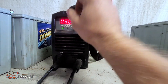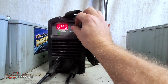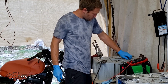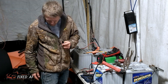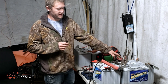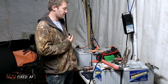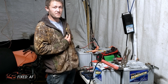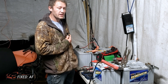Welder hooked to the battery. I cranked it up to 30 amps, let that sit for a couple of minutes until I saw some bubbles, then ran it right up to 85. Here you can see me in a panic removing the vents on the battery I'm desulfating before it explodes on me. I've spent about six hours on these batteries and I've got one left. While I've got them to hold 12 volts, their amperage isn't very great, so I'm probably going to have to buy new batteries anyway. That does not mean I'm not going to drive this bitch — I'm going to stick them in and see what happens.